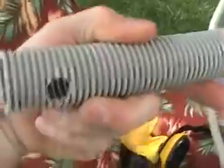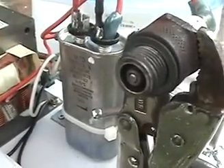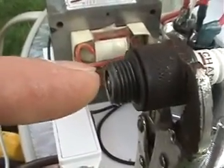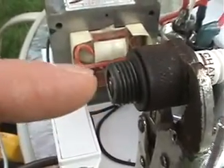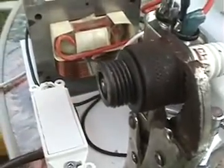If you want to see what I've done here — taking it apart — there's my tube with a hole in the side, which just fixes onto the spark plug. That's my modified spark plug: no resistor, no J electrode — it's been cut off. Both the center electrode and the exterior electrode are filed down to exactly the same level. And that's it — I'll post this on YouTube; hope you enjoy it. Thanks.